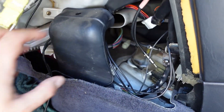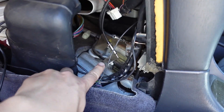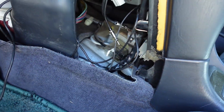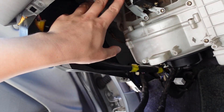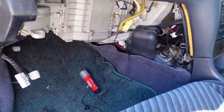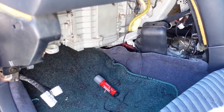Pull back this intake duct piece and the ECU sits in there with a 10mm — that goes there, and 10mm is there. Throttle computer goes right here, another 10mm up here, and then a 10mm down here. Actually really easy to get out if you have tools, which I didn't since I was using an adjustable, which is fun.